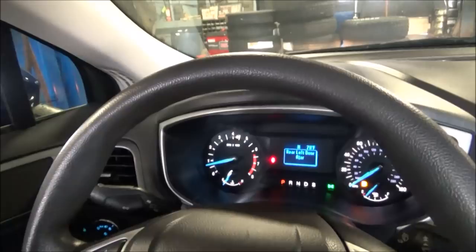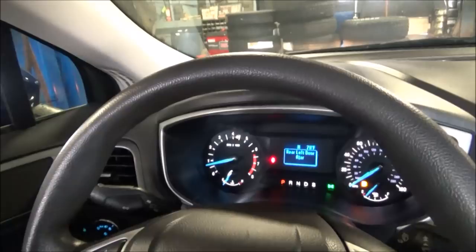As far as what I want to do next, to keep this easy, I want to go to the scan tool — this being a late model vehicle. The reason I want to do that is because I'm sure there's going to be a lot of data available to us. We can look at AC pressures, AC clutch command statuses, and all sorts of relevant info to help troubleshoot this AC system. If this were an older vehicle, I might go straight to the gauges, but I'm not going to do that on this one. Let's get the scan tool hooked up.